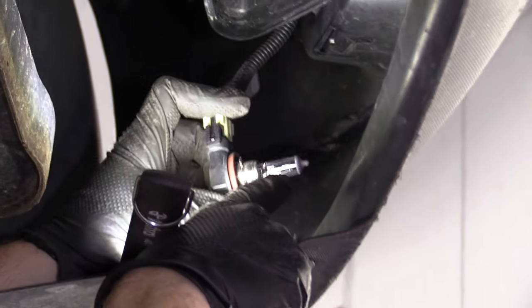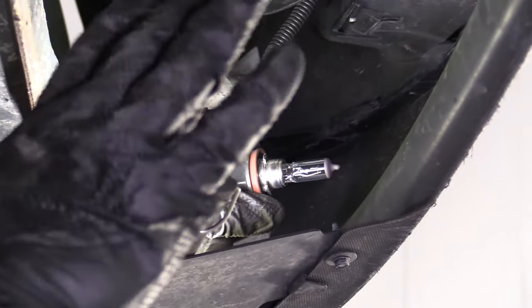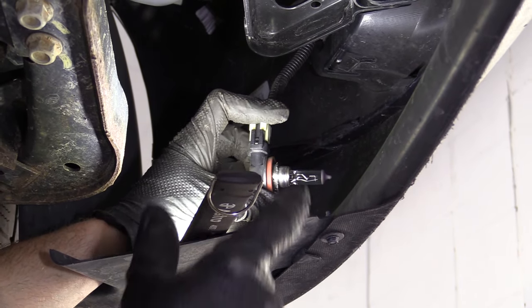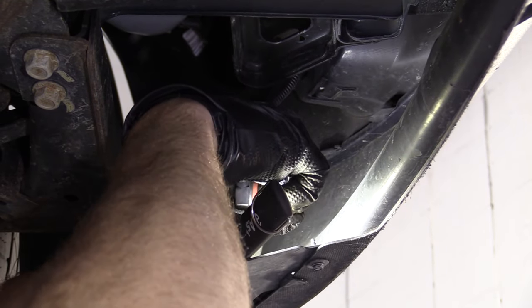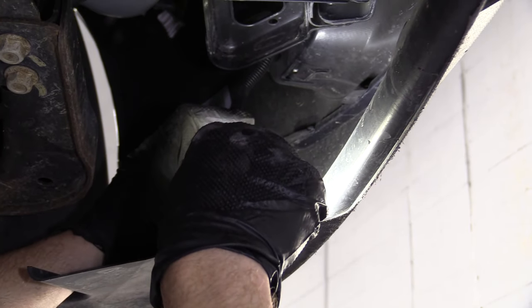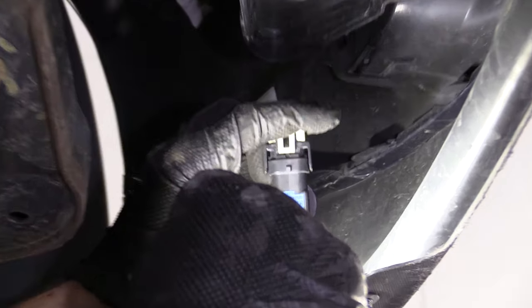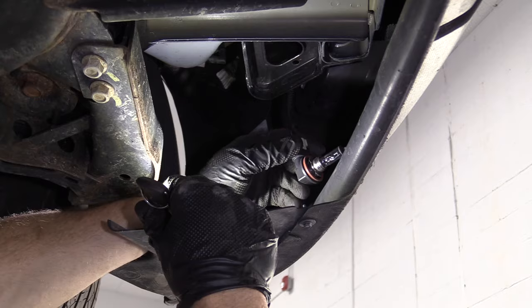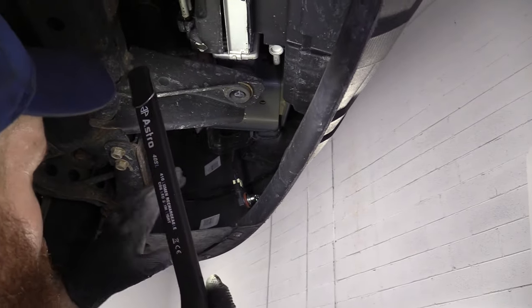You want to be very careful not to touch that glass, especially if you've got oily hands. Even gloves aren't really the best to touch the glass, so if you can avoid it, that's always great. See if it looks black in any way, discolored, swollen, or if the filament inside looks like it's got any crusty buildups. If that was the case you'd want to replace it. Right on the back of the bulb you can see what the bulb number is — it's an H11 on this particular vehicle. I'm just going to leave this down to dangle, and I'm going to do the same to the other side.